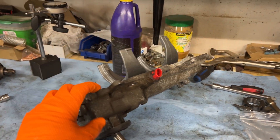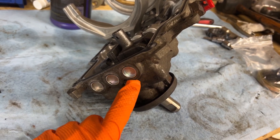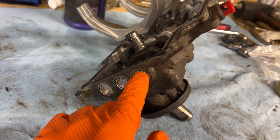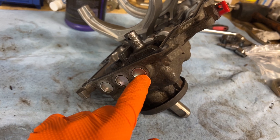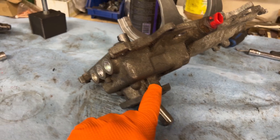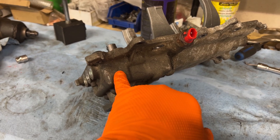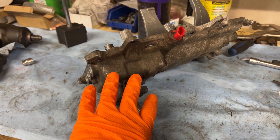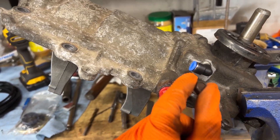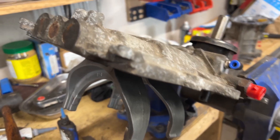I'm just finishing up the top cover — I put a new gasket in it. One of the big problems with these transmissions is it leaks fluid out through the back ports. These are normally just a rubber plug, so they provided these little frost plug-style inserts that get pounded in there — so those are in. I'll rebuild the shifter after; I've put this in temporarily to make sure all my gears are working. Now I'm going to drill here, tap it, and put a vent in this transmission — it doesn't have a vent. That's where I ended up putting it, just high enough to still get the bolt in, and I can run my line down and over the top of the transmission.